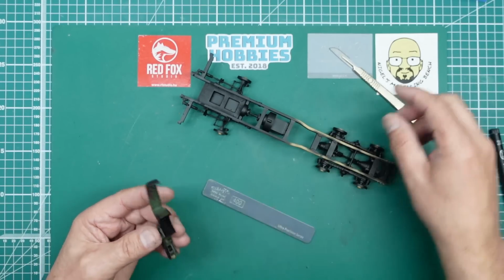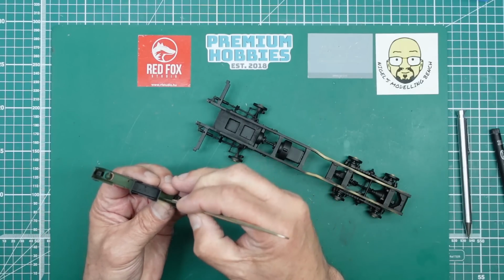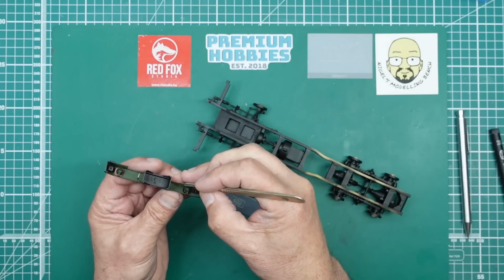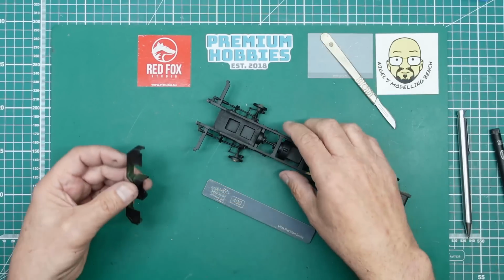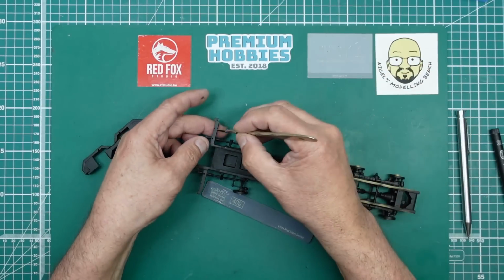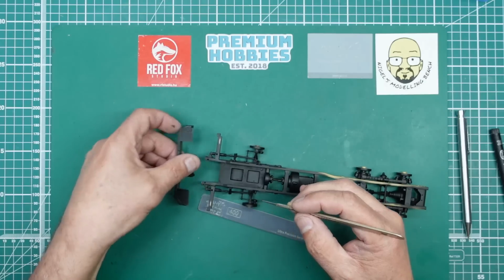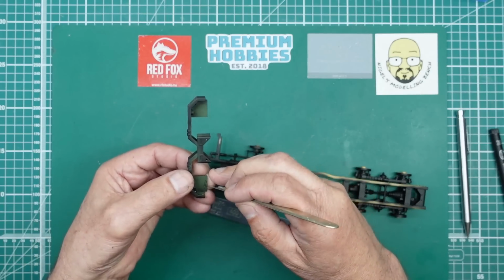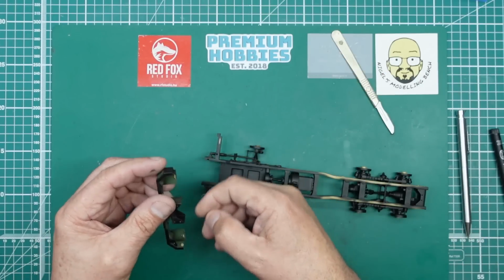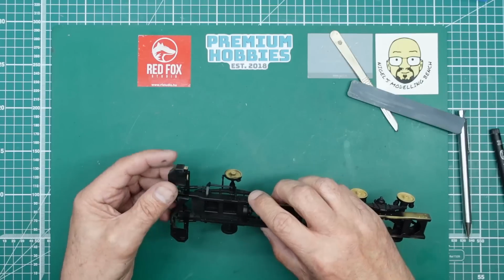As long as we get a good contact on the end of the bumper, I'm just going to scrape down just down the inside of that line there. That's where the end of the bumper rail is going to come. Like that. And then that's going to go in like that. I guess what we could do is take some paint off of here as well, and here, and there, and there. And the glue will work through the paint, but it's just better to not have any paint there if you can help it. So that's going to go back there.